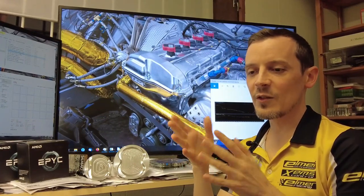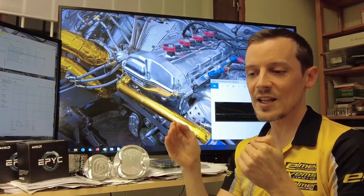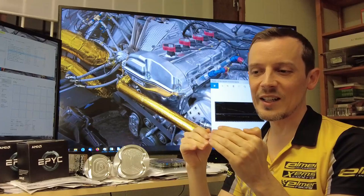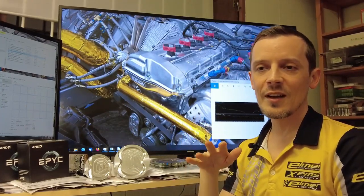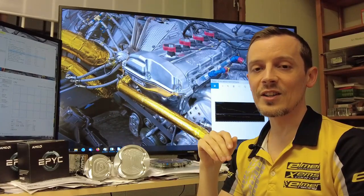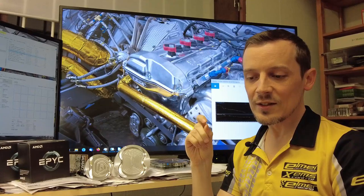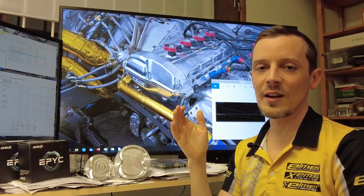The power amount is kind of wishy-washy on a chassis dyno at these small amounts — even consecutive pulls vary, and you can't say if it's 13 or 15 horsepower; that's completely impossible. Even five horsepower differences are difficult to see. But we're looking at trying to gain like one percent or something — so two percent is a significant number in this scope.